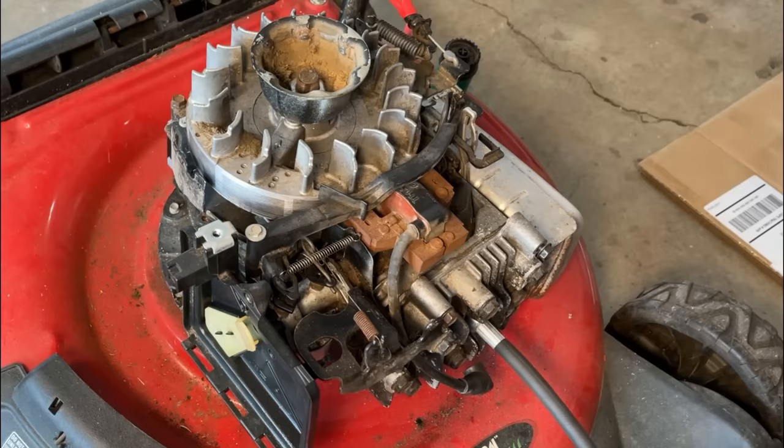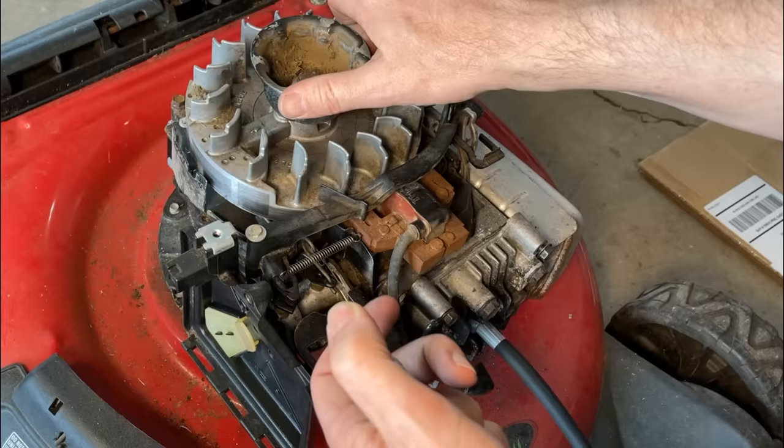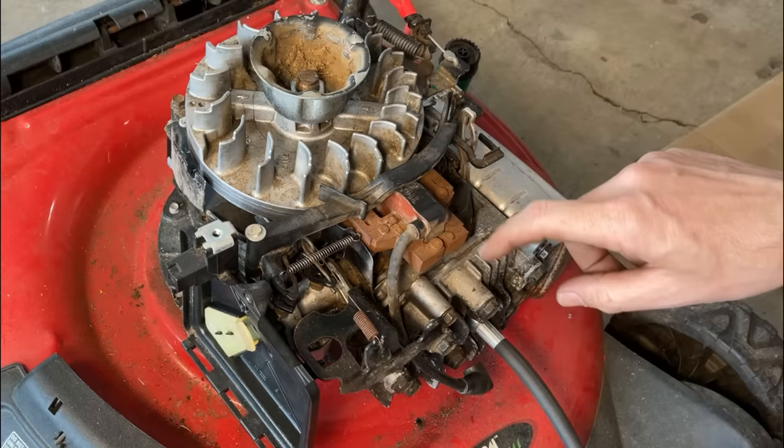All right, it's actually the next day. Wanted to sleep on it, so I resecured this cup, torqued it down. I also pulled the fuel tank off and hooked up this line for the leak down tester. So I started rotating the engine with my thumb on the end here until I got to the compression. And what I thought was compression is actually suction. So that kind of backs up my theory that the valve timing is off.